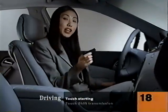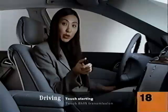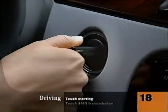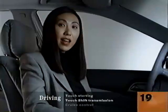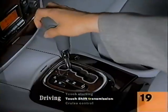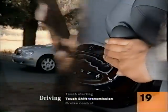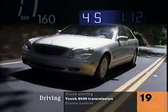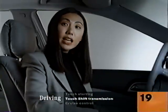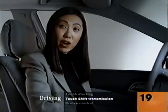Unlike other keys, the key for your S-Class doesn't operate mechanically — it reads a code through the infrared lens at the tip. The key and the car's computer generate identical codes on a random basis every time you start your car, so you don't have to crank the ignition the way you do on other cars — just turn it and let go gently. The S-Class features the touch shift automatic transmission, which gives you manual style shift control when the selector's in the drive range. You can downshift by tapping it to the left, or tap it to the right to let it upshift. This display in the tachometer will tell you what gear range you've selected. You can also use it like any automatic transmission by leaving it in D — it will adapt to the way you're driving to help you get the most response or, if you prefer a more leisurely drive, the most economy.